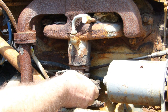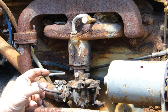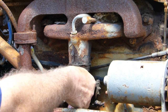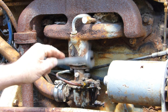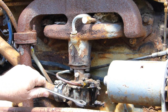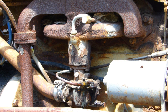So what we're looking for is that we have fuel coming out of this fitting. That should be just plenty. We'll let that run for a little. But obviously the needle and seat's just in here. You don't want to tap that hard, eh? Well, look, it's no go, so let's take the carby off. We'll go and turn the fuel off. That's fuel off.